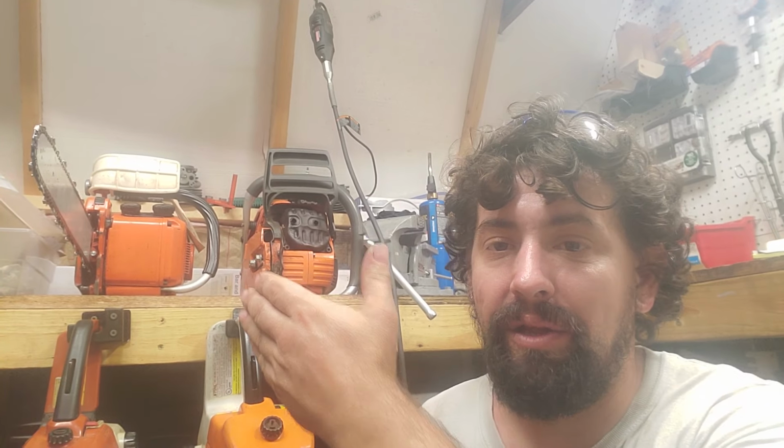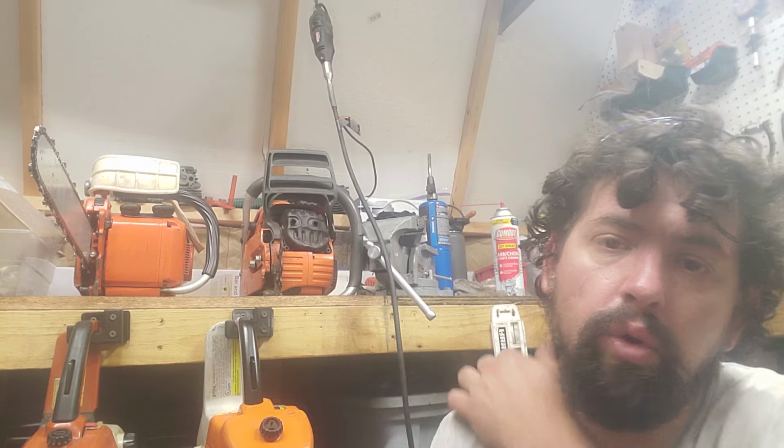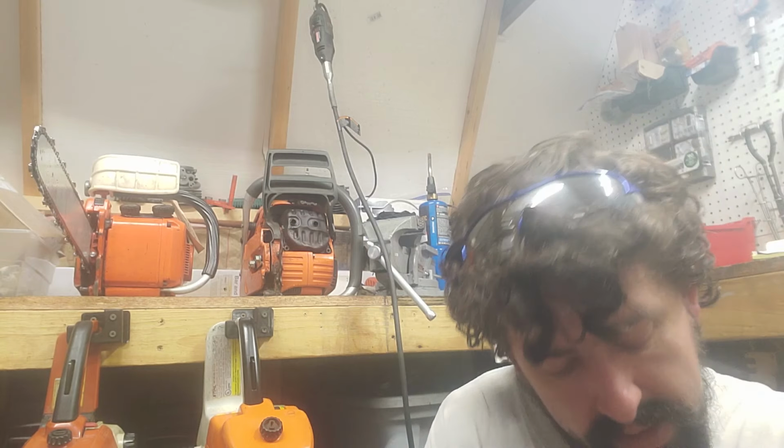1 1/4 on both. I have video of me nightmare wrestling an 028 where I had the carb screws out at like 1 1/4 turn strong, almost 1 1/2 probably, and I had never reset them, and I couldn't get that saw to go at all. And I didn't even think, because I'm thinking, well, 1 1/4 should work. But it doesn't always. And so with this one right now, I can't figure it out. I can't even get it started long enough to adjust anything at all, just to get me a good starting point. I have tried various spots, but again, that's a big heavy saw, and pulling that cord each time you make a tiny adjustment to see what the saw is doing and the carburetor is doing, is not so easy